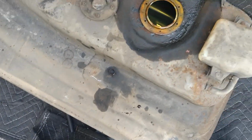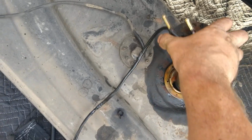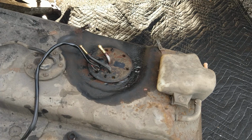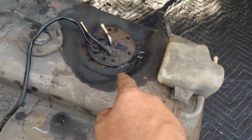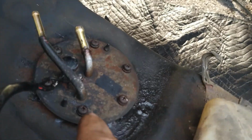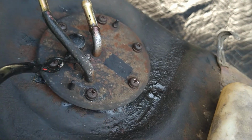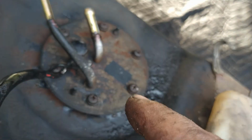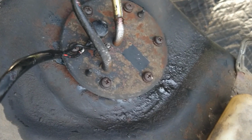Anyways, yeah. All right, we're going to go ahead and set this bugger down inside and get it in place. And then we're going to get all the little bolts that we got down here and get them all started in. And we're going to go just like you would on a car tire. From this side to this side to this side to this side. And get them all snugged up. And then half tight. And then all the way tight. So it's a three or four tightening process. Okay? So work your way slowly.